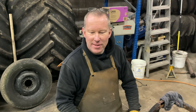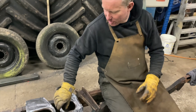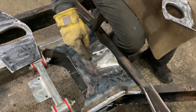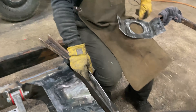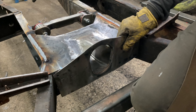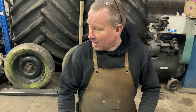So we're nearly at the end of getting that cross member back in - remember the X thing that we chopped out? We've used a lot of parts of it: that was the front bit, that was the back bit, and that was part of the bottom and the other piece which is underneath because we've actually got the chassis upside down at the moment. I've had to extend all the bits, make them a little bit longer. So now we're at the stage where we can weld all these pieces back in to finish boxing this all back off. Then we can remove the cross member, remove these bits, and do a couple of little other bits while we've got it upside down.